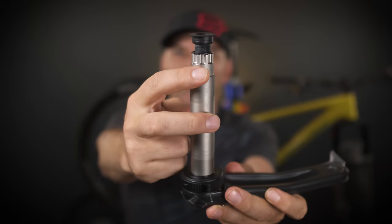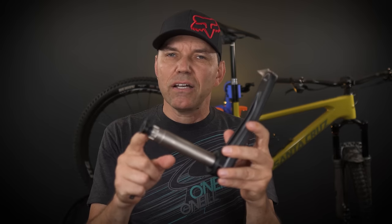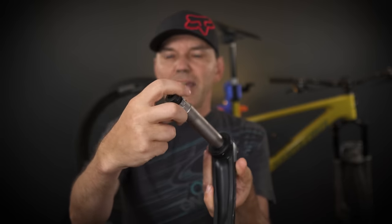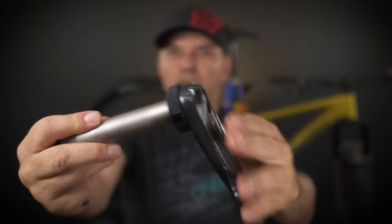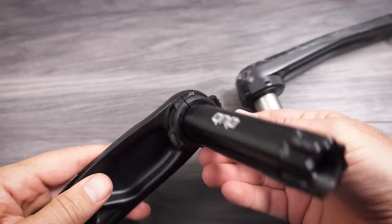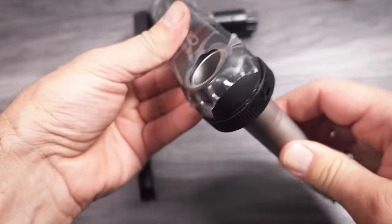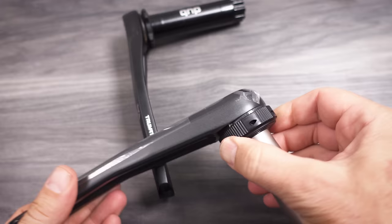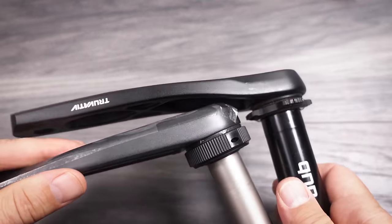On the spindle itself, there's now a little shoulder that most probably prevents over-tightening the drive side crank arm, making it easier to remove. As for taking out the side-to-side play on the spindle, we don't use that tensioner anymore. Instead, we use this ring right here next to the non-drive side crank arm. You might recognize this from the SRAM design, even though this is a nice big thick round adjuster — which probably tells you that the SRAM patent on this wasn't rock solid, so Shimano was able to go around it.